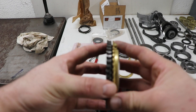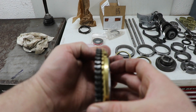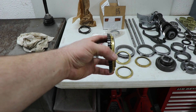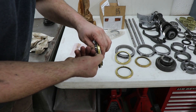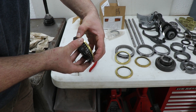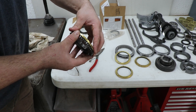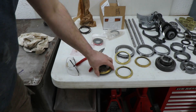An additional item to check is, even if you're getting good friction in between, it would be the size of this gap between the synchro and the gear face. That gap right there can make a big difference about how much life is left. So if you've got a brand new one and it might have say an eighth inch gap versus one that's almost touching, that one that's almost touching doesn't have hardly any life left. And even though it is making friction and could be used, you probably want to replace it. And that's a quick way to check the synchros in your transmission to see whether they're worth reusing or not.